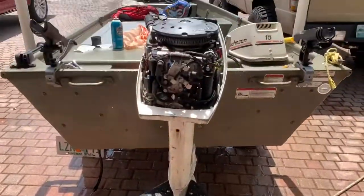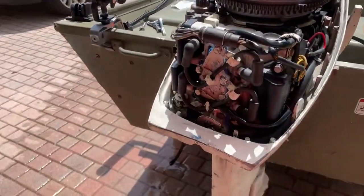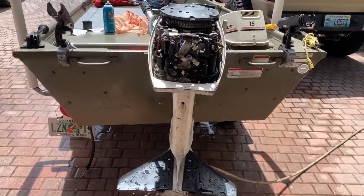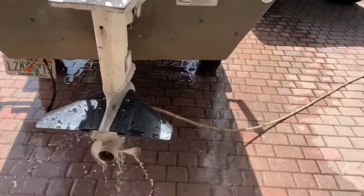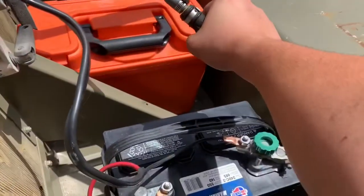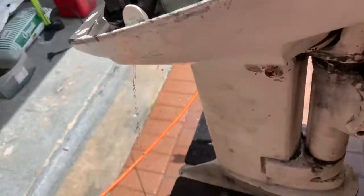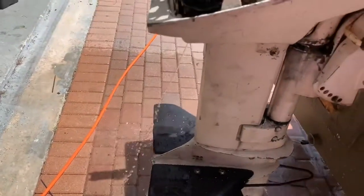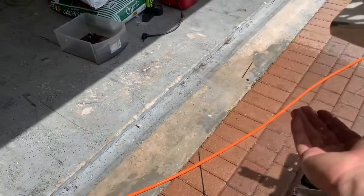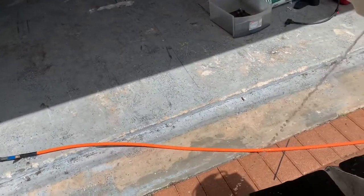So I'm back. What happened is that barely any water was trickling out and I was like, what in the world is going on? So I took it back in, removed the lower unit, sprayed a bunch of compressed air into the block, and now look how it pumps out water. It's pumping water strong — there we go!